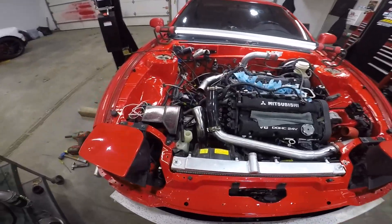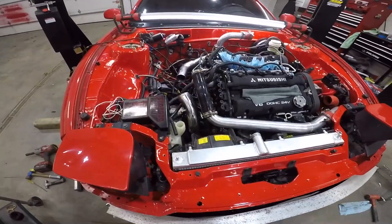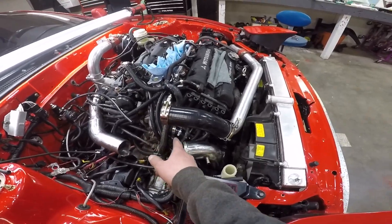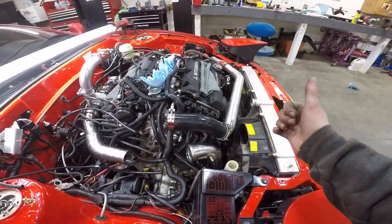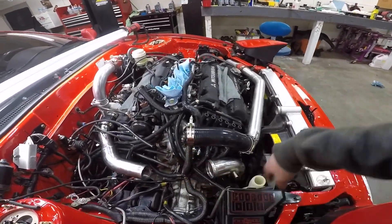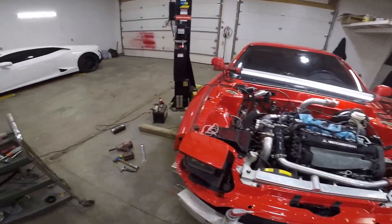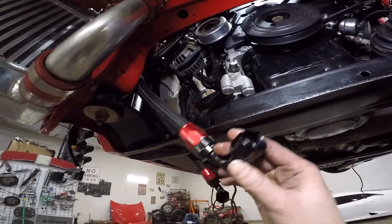I just realized I haven't turned the camera on in a couple hours. I got the radiator in — that's really simple if you took it out you know how to put it back. The only thing people mess up is that the bottom radiator hose hooks up both ways, but if you don't have it oriented so it immediately jumps up, it'll run into your shift linkage. Don't put it on backwards — if you flip it around with that side down, it'll slowly come up and rub right against your shift linkage.